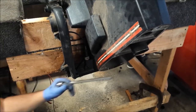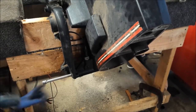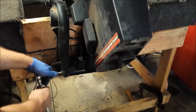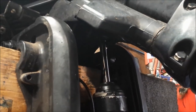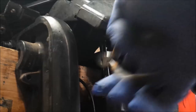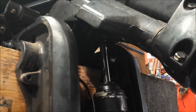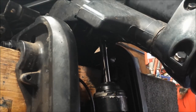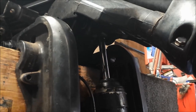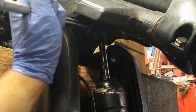This one will go all the way through. Now up inside here is the pin that attaches the top of this ram to the lower unit — hopefully that doesn't give me any problems. Maybe because it doesn't usually see water, it won't. That's all I did to get that pin out of there — now it'll hammer through and come out the other side. I do need to go up a little bit more on the motor for a little more clearance. Now unlike bigger motors, I can't just go into the side here — I kind of got to go at an angle, but let's hope it just comes out.